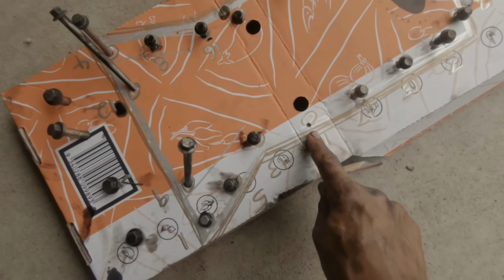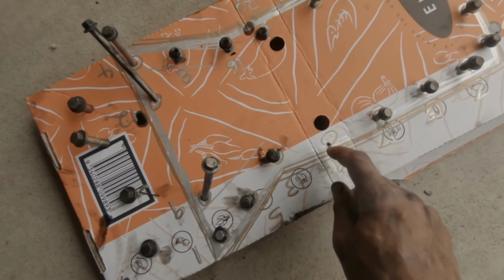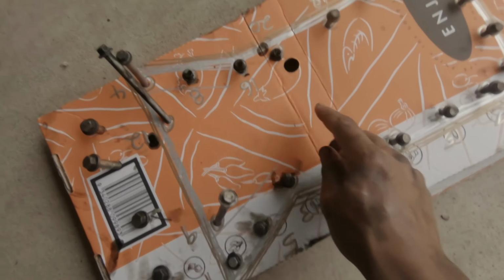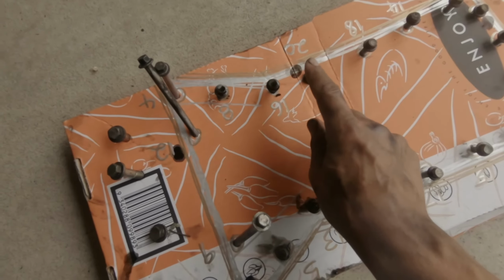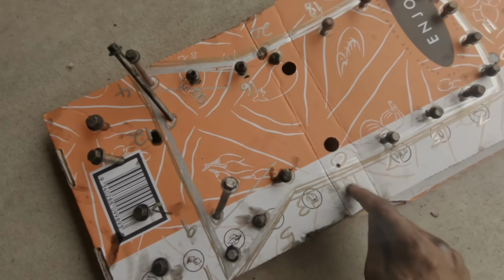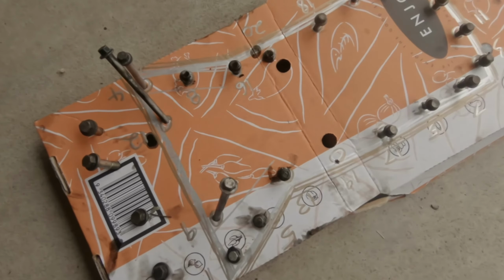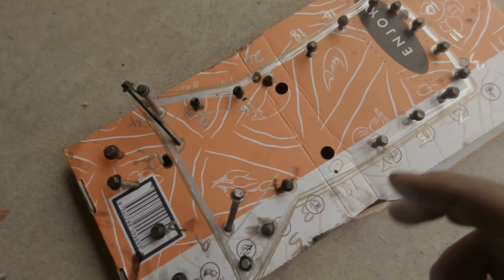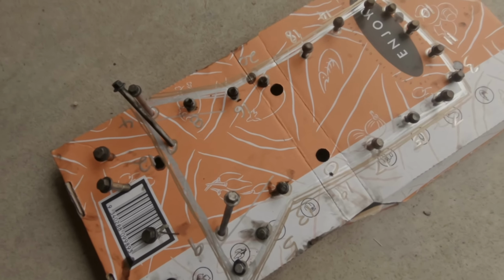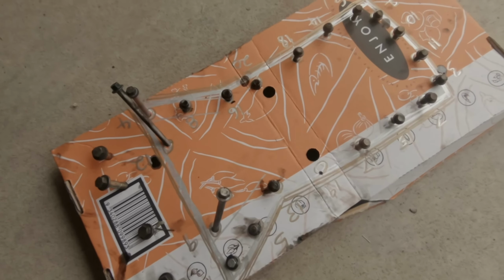So I've left bolt 19. I cracked it off, but left it in there finger tight, and then took off bolt 20. Just as I was taking off bolt 20, the sump dropped. So luckily, bolt 19 and those two studs that I left in earlier from the downpipe from the centrifugal oil filter are now holding the sump in place. So yeah, it's important that you leave them in, otherwise the sump is literally just gonna drop on your face.